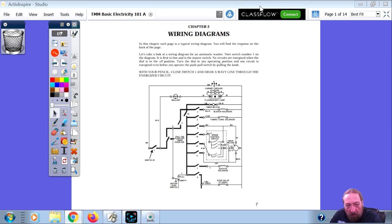With the assignment I gave, we're going to start off with an old Whirlpool washing machine diagram — a Whirlpool belt drive washer. They went to direct drive, and I think even the direct drive is being phased out. What you're supposed to do is close certain switches and then highlight or draw a line through the circuit that is energized. Whenever I go to a machine that's not working, the first thing I want to know is: when certain switches are closed, what should be running? How is current flowing through that diagram?